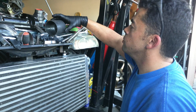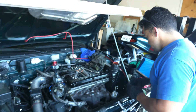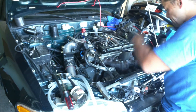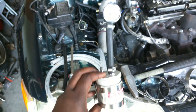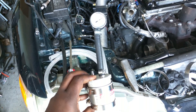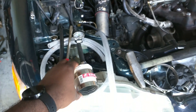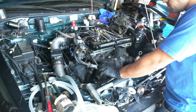If you guys know what brand that is, tell me. You know, it's the trolls on there, whatever. Don't feed the trolls. It's a learning experience. Here's something that every DSMer knows about right there - that's that Lowe's special right there. It's a Boost Leak Tester. Every DSMer should have one of these in their garage. There are links to how to make those and they're easy. I think that whole setup cost me $7 or $8. Because these cars leak like a sieve.